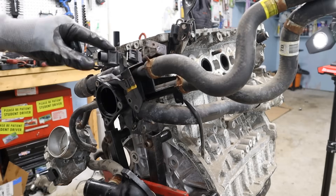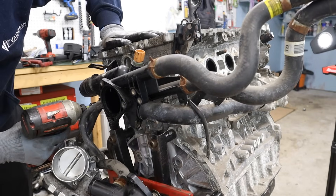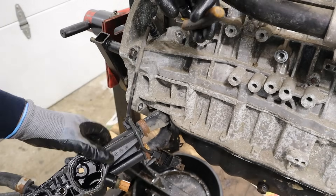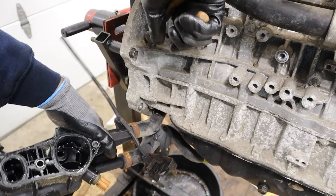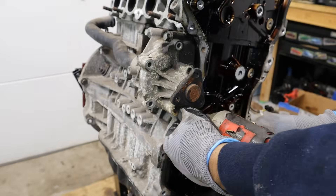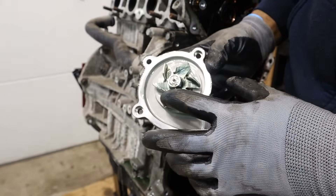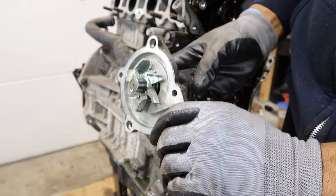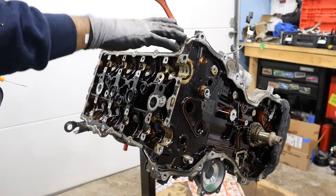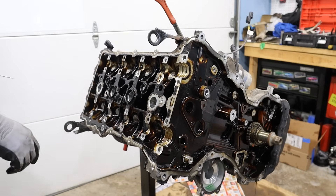Here's the coolant crossover pipe — surprisingly made of metal. I'll move this bracket out of the way. What's with Hyundai using 13mm? I thought Japanese brands don't use 13s. I'm going to remove the crank position sensor very carefully so I can get the rest of this stuff off. That's also where the coolant temperature sensor is. I'll knock the water pump off while we're at it — the housing's made of metal, and the impellers are metal too. I really like how Hyundai put these hooks in for moving the engine. But they really put thought into this because they've been eating warranty on these engines — it's worth it for their technicians to pull them out a lot faster.